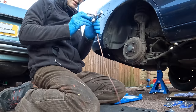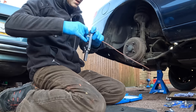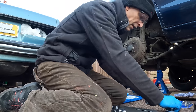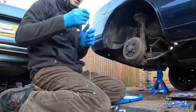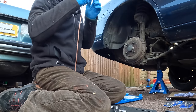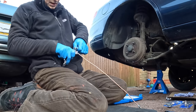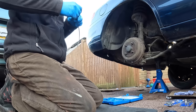A-flaring we will go! This is easy on this bit — the one on the other side is going to be trickier. Something useful to remember: put the fastening nut on before you flare it out, otherwise you've wasted your time. Just for a second I thought I hadn't put it on — but it is on. That end is good.